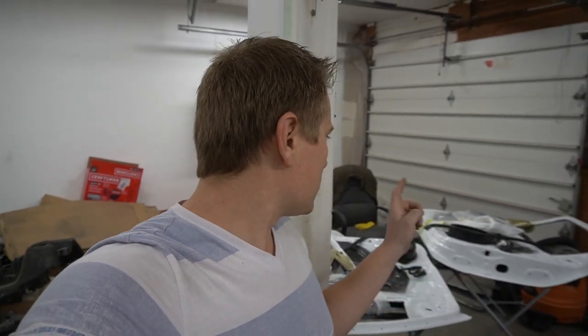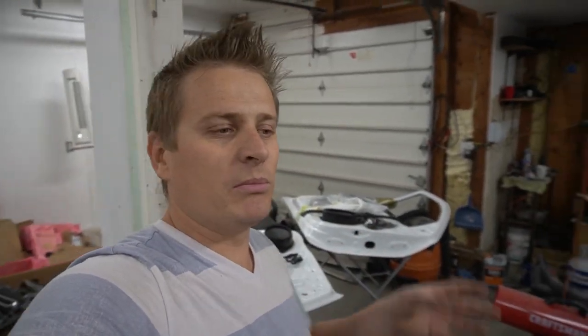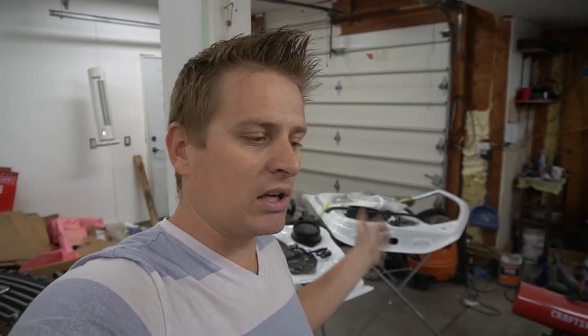Also, two of those stands are busy. I can't put the hood on the third stand because there's a broken chain on it, so I need to at least install the one door. But hey, this is the time. Let's install both of them in place, cut the moldings out, and cut the letters off of it, and then I can sand it with the gray Scotch-Brite and scuff paste. That's the plan. Let's put those two doors on and then move on to the hood.